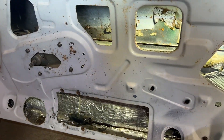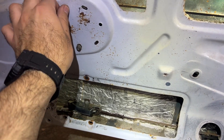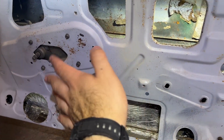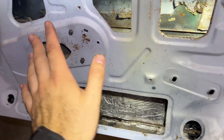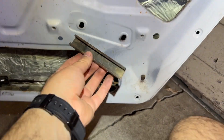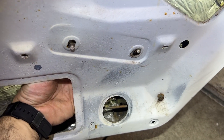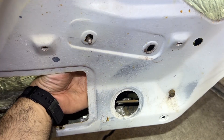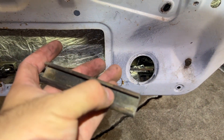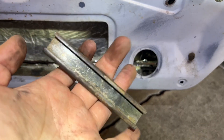The regulator is now on - just hand-tighten the screws. There's gonna be some finagling when you're trying to get it in, but it's not bad at all. Next up we're going to throw this guide piece in, which goes right here from inside out, with the nuts. But before we tighten it down hand-tight, we're going to put some grease on here to make things easier for the rollers to slide in side to side.